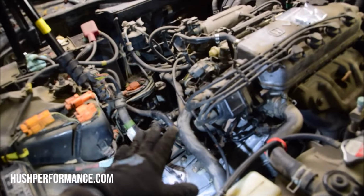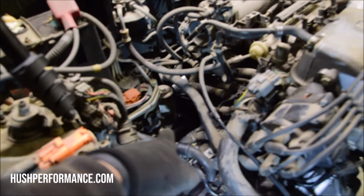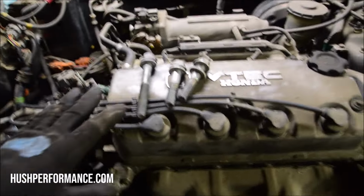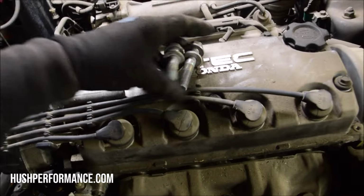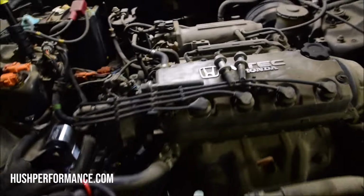And so underneath the car, you'll be able to move the engine to align the rear T-bracket with the transmission and the engine. Because the rear engine bracket is the same as the manual, you'll just reuse the hardware from the original T-bracket as well. This one is the one that went up top, and then these two are gonna go in the back. And like I said, this engine should rock. See, like that? That should be enough for you to be able to get all of those started.